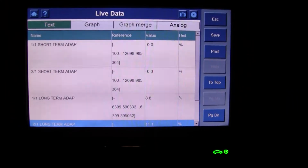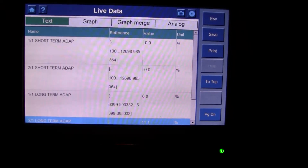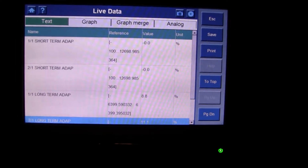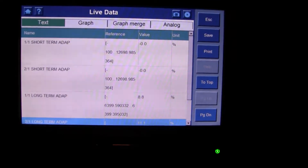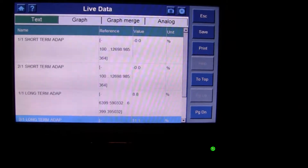That's going to give you the best operability for your engine. The computer uses the O2 sensor data to constantly adapt the amount of fuel and air mix ratio in order to create the perfect run for the vehicle and keep it running properly, and also for fuel efficiency and the environment, because you don't want a bunch of fuel being dumped in, or you'll ruin your catalytic converter, and it also pollutes the environment.